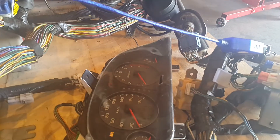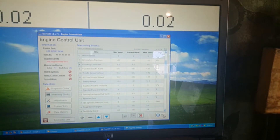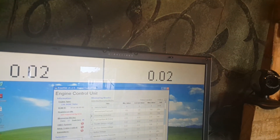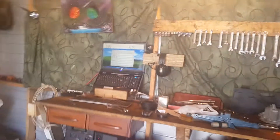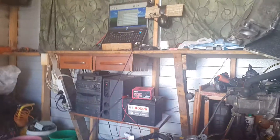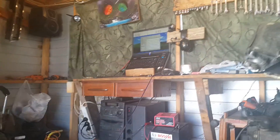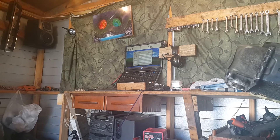Every time it's a different strategy - ignition's on, key over there. Press start and look at that - instead of being 1.10 volts, it's 0.02 volts. Something's very bad with that mass airflow sensor. We blow through it and nothing changes - still 0.02 volts.